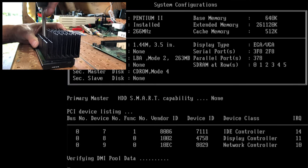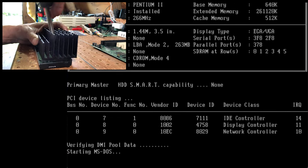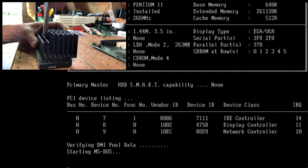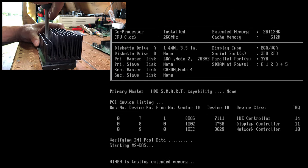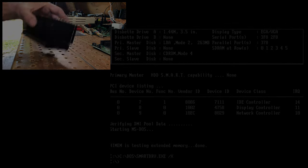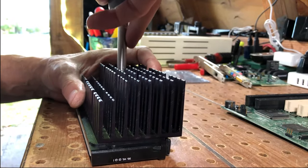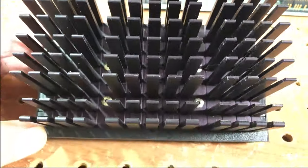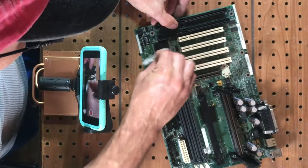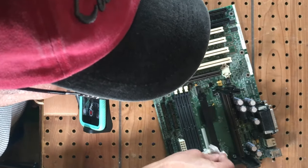At this point, I thought that most of my bugs would be over and out of the way. Everything went fairly smooth at that point, and I was excited to configure device drivers after a flawless DOS install. This was the point it all started going downhill again. After a reboot from the DOS install, I was greeted with beeping sounds and IRQ errors from the network card. Usually this means it needs to be moved to another slot to properly get its resources. I tried that and had the same issues. No settings in the BIOS helped either.